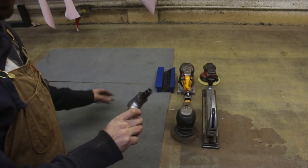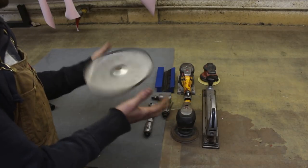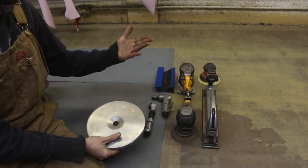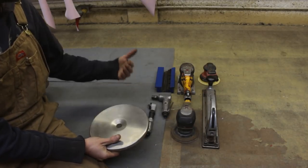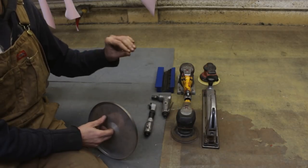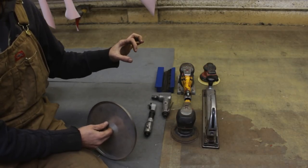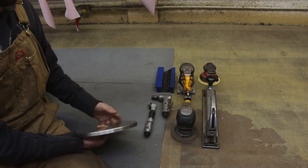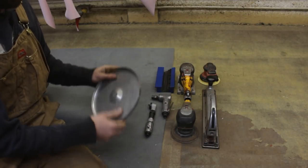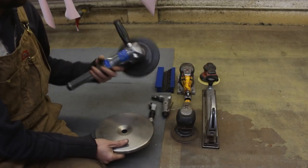All right, next, this another die grinder, a little air ratchet, 1/4 inch, shrinking disc. That's for dents. I've never used that before, but when you have dents or pushed out areas or stretched sheet metal, you just use this to hit a local spot, and then with a wet rag or with a spray bottle with water or even with air, you can cool down the area and it shrinks and you can bring the metal back to normal. Otherwise you can just push it in and it's gonna boom, go in, and push it out and it's gonna boom, go out. But with this you can actually shrink it back to the size that it needs to be. And to use that, he gave me even this.